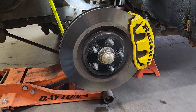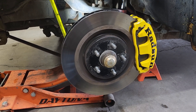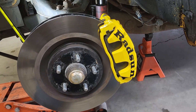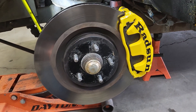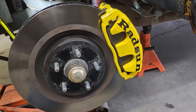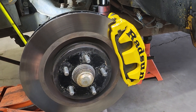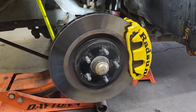What I have now: I've swapped to 5-bolt, I've got GT500 14-inch rotors, and those are C5 Corvette calipers. It's a slight mismatch — I think a C5 is a 13-something inch rotor — so it's not a full match, but they work really well.